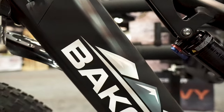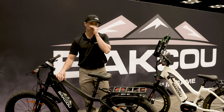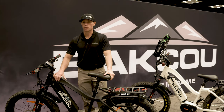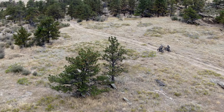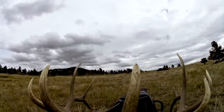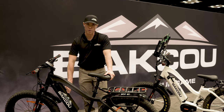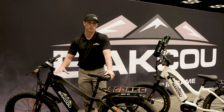Next are our batteries. We use only top-end lithium ion cell batteries. Quite often we're asked how far can I ride. Well, there are a lot of variables, but in all of our testing using the bike as it's intended — on an elk hunt in Idaho with a 170-pound rider — we were averaging two miles per amp hour. So with the 14.5 amp hour battery that comes on the Mule, we're averaging about 28 to 29 miles per charge.